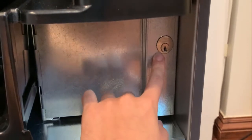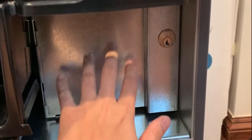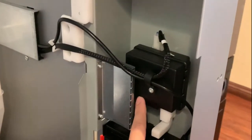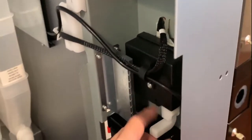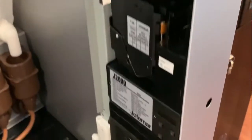You have your coin changer. This is your overflow coin bucket — this is where coins fall through when the coin mechanism is full. This is your coin refund motor; once the coin mechanism is full, it gives you a refund and the coins go into this bucket.